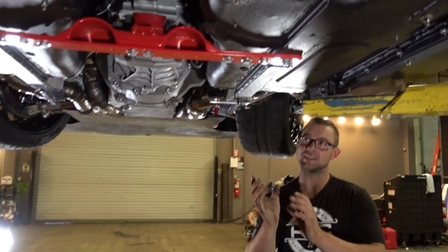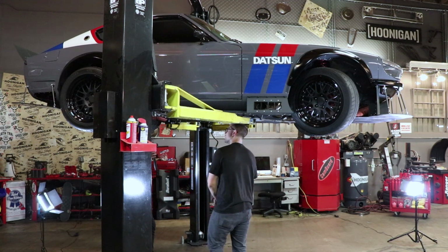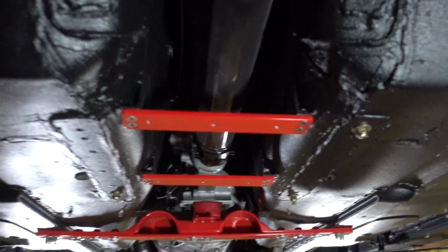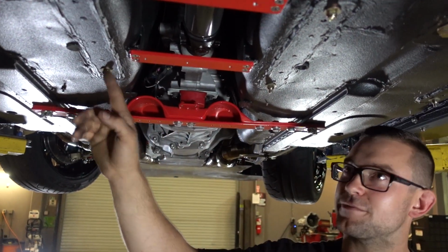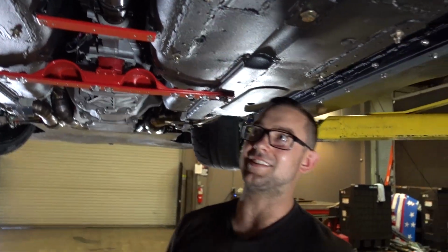But I had to machine that down on the sides to fit through the factory rectangular shift port. And then even though you have a 10-point cage with gussets, these are really holding the car together, right? That's the secret of the chassis rigidity? Kind of, yeah. These aluminum ones are kind of safety driveshaft hoops, just in case. And then I also mount the closeout panels that I have off on that. All this is actually closed in full race trim, but you can't see anything with all that on there.